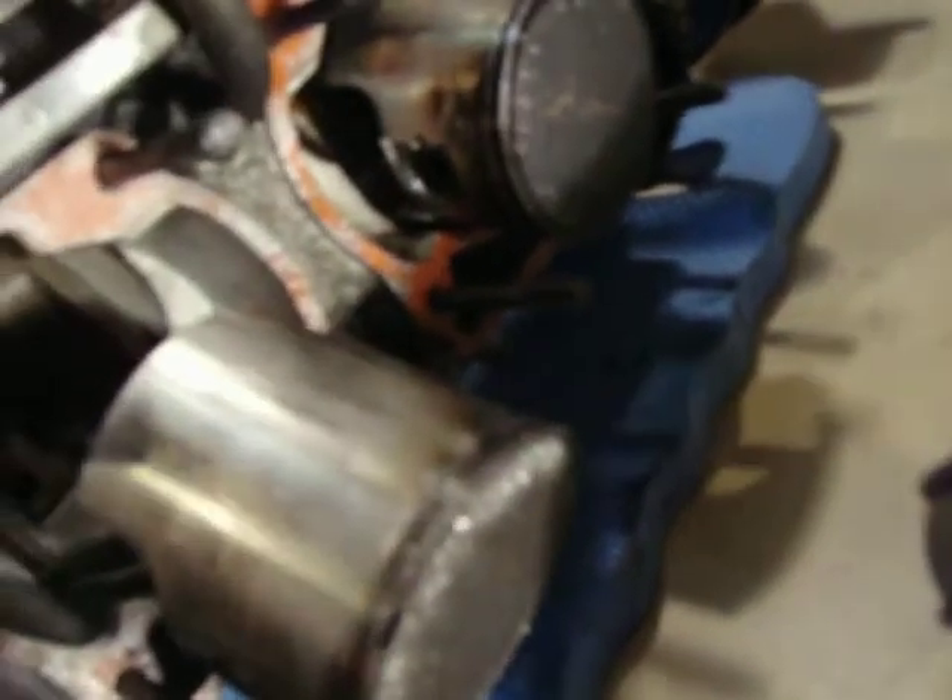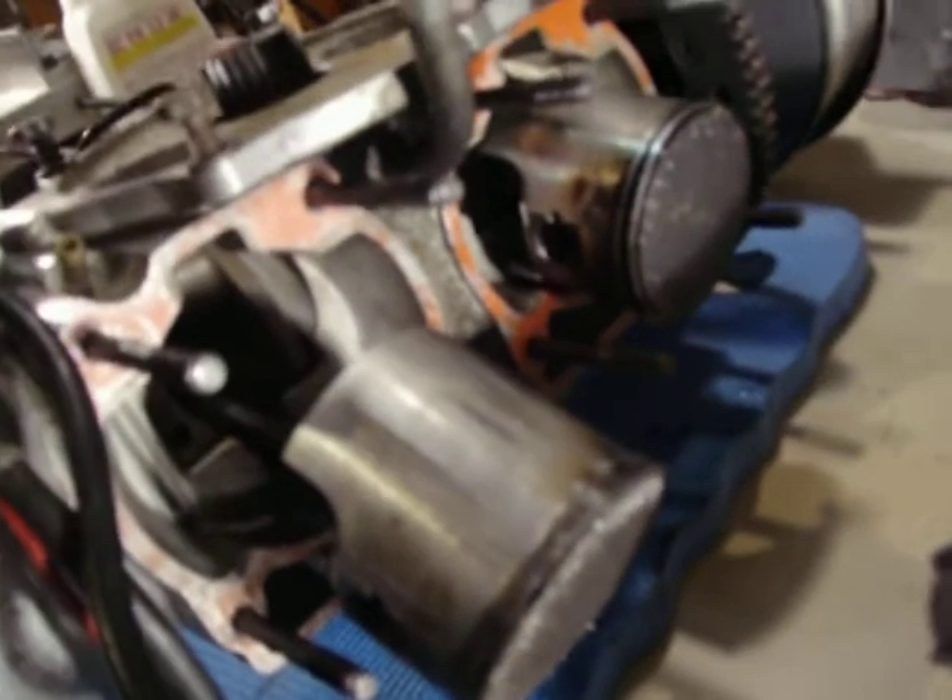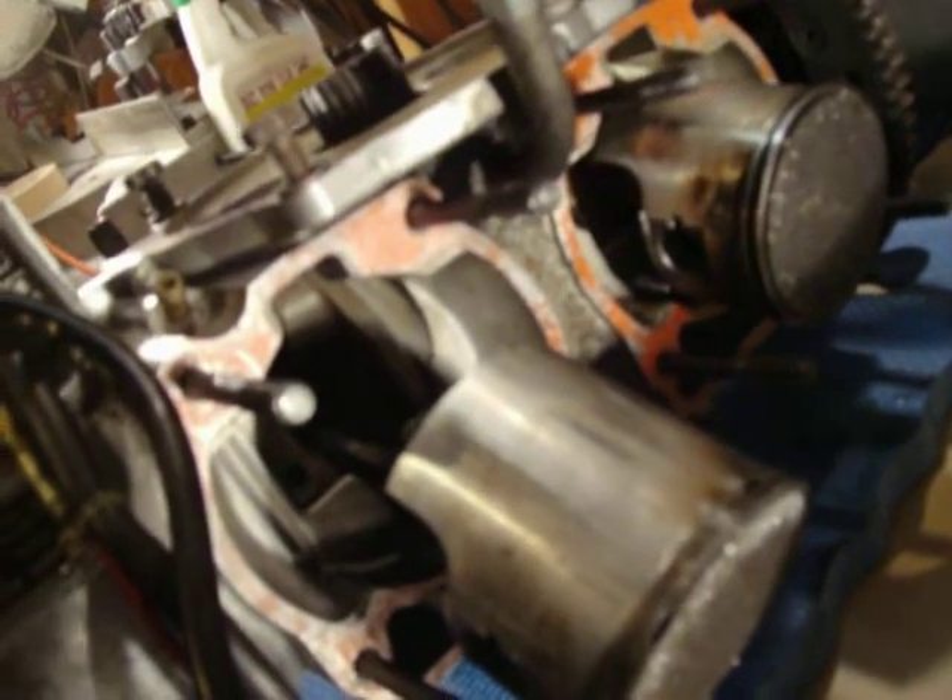You'll also notice that this piston is fairly dry. It looks like this problem was caused by a lack of oil in one of the cylinders. Unknown is the reason at this point in time, but this cylinder seems to have no oil in it, and it seems that's where the bearing actually blew on the crankshaft.